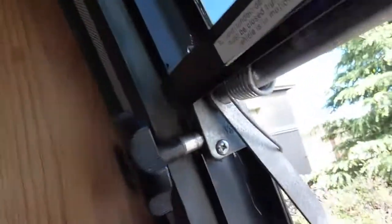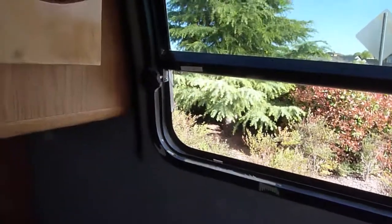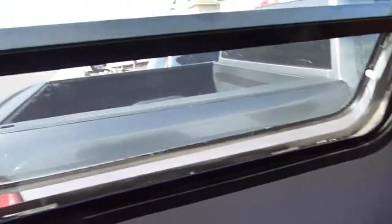So this is a common failure in these rear windows. This little pot metal arm — when you twist this it goes in and out. You can see it kind of stops dead right there, which means it doesn't pull the window closed. Now I've already removed the window, because it literally takes seconds to take that window out. I'll show you on this side exactly how to do this. First, you need to remove the screen.